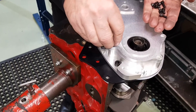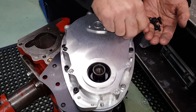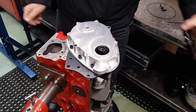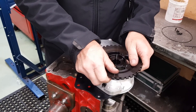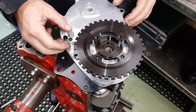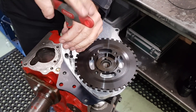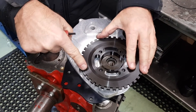Here are the screws — I'm just going to pop a couple in just to give you a visual. Now I'm going to put a crankshaft pulley in. It's not a standard stock one — this is a management one because I want to show you something else we've done while making this. So if you're running without a distributor, you'll need one of these. Once you push this in, it will centralise the oil seal on there. Now is the time to tighten these up because now you know the crankshaft is centralised, the pulley is centralised on the oil seal.